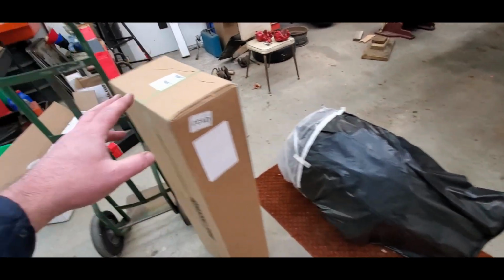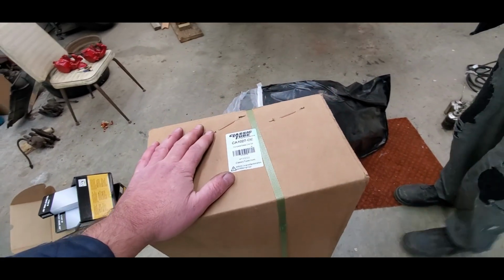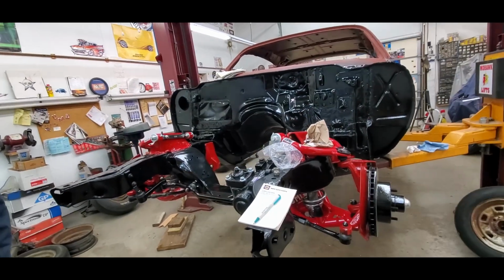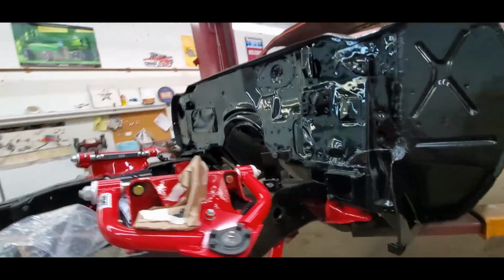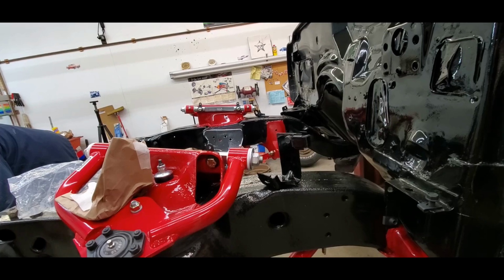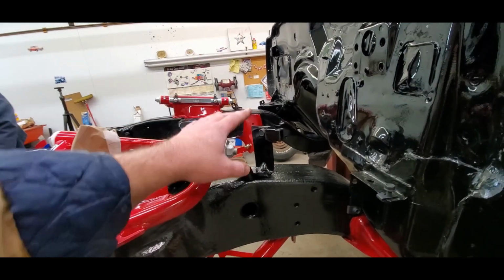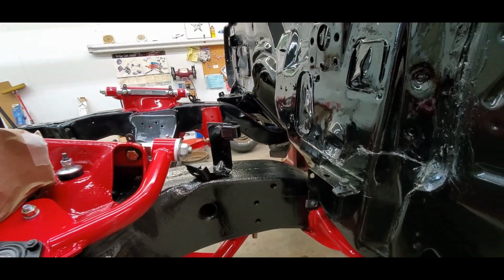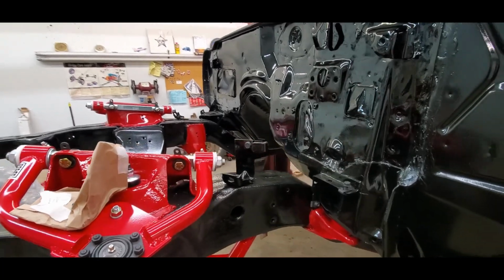And if we're making lines, because we think we're sending these back, we ordered these a while ago because somebody was in a hurry, not thinking about the fact that about half of them we're not going to be able to use anyway, because we got that Ford 9-inch back there, and then the Hydro Boost sticking forward enough that, probably not worth the hassle. But because GM spent time and money making this silly little bracket for the brake lines to go through, when we do bend lines, I really want this inner fender on here, just so we can, one, maybe try to even still use these, but two, find out why it's here. There might be some structure right in this area that the inner fender corresponds to that I could accidentally be in conflict with, and I don't want to do it twice.